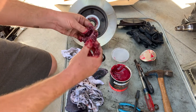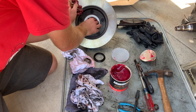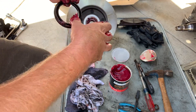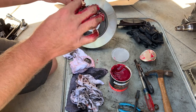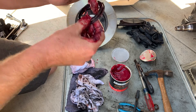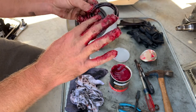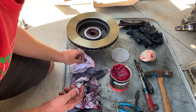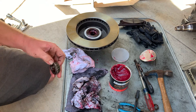Now that we have a heavy amount of grease on this thing, we're going to slide it right on in. We're going to take our wheel bearing seal and get it lubed up so that everything just wants to slide into place. It has a rubber seal on the inside here, so just keep everything nice and lubricated so nothing wants to hang up. Now we're going to take our seal and seal in the bearing. Once we get the front bearing packed, we'll actually stick the rotor back onto the knuckle.